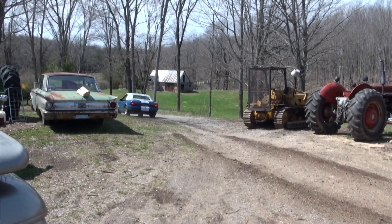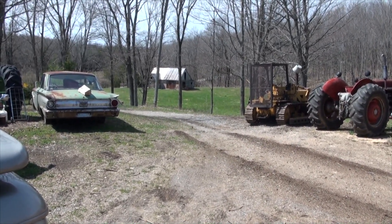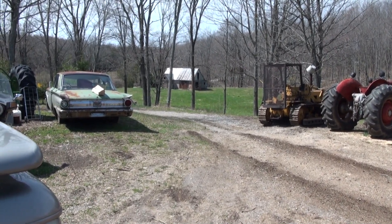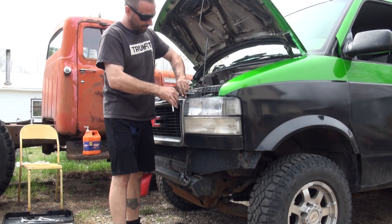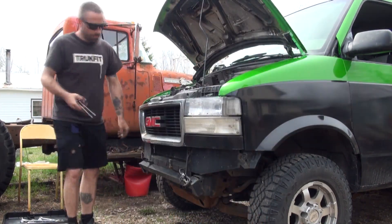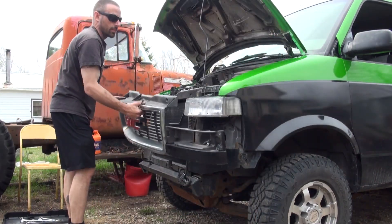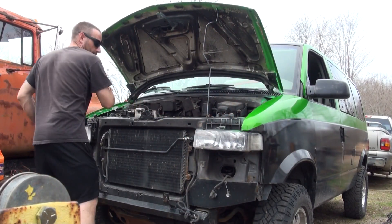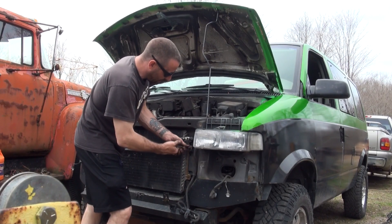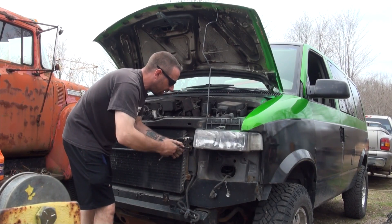That's my dad boys. Now it's time to get rid of the grill. Next the rad comes off for the air conditioning — make sure there are four bolts holding it in after you get the lines undone.